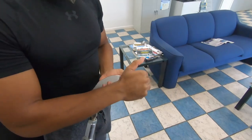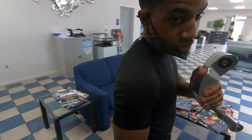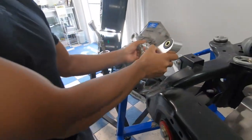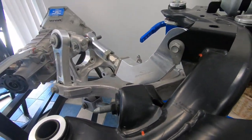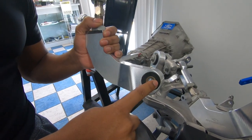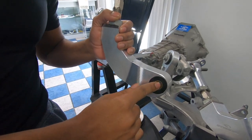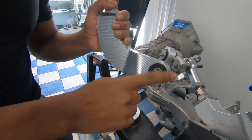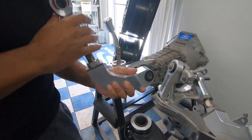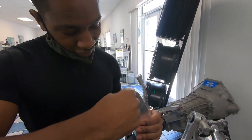So we just talked to the guys over here. This part - the camber arm which goes right here - it has a pin on the inside with a Delrin bushing. When Delrin is not lubricated it binds and makes noise. What happened was this pin has lube between the two surfaces and it dried out - that's actually what's causing the squeaking. So if you guys have that squeaking issue, check these out. You might have to take this out and lube it.